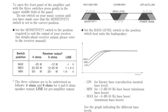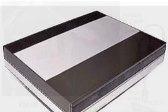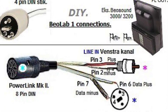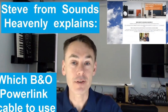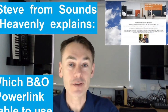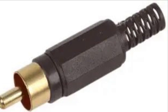If you're unsure, the min setting is the safest setting to start on, as it will provide the least power to the speakers and have the least chance of doing any damage. My recommended receivers for Penta Ones are either a Beocenter 9000 or a Beomaster 5000 or 5500 — that's if you want the displays to work. It is possible to MacGyver some kind of eight-pin DIN to speaker link connection; speak to Steve at Sounds Heavenly. The final method of connection is the phono input, which is a line-level input — basically a headphone-level input.